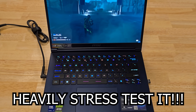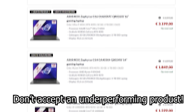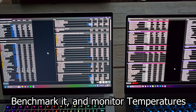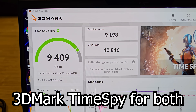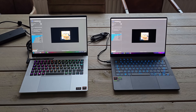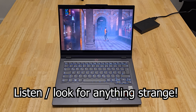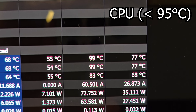It's very important that you stress test this laptop in the beginning. You paid a lot of money for it, so it should perform at its absolute best. To test whether it works correctly and doesn't blue screen or overheat due to a defect, we're going to benchmark it and monitor temperatures. I always install Cinebench R23 for a CPU stress test and 3DMark TimeSpy for a GPU and CPU mix stress test — both are free online. To check temperatures, download HWInfo64, run the stress tests, and watch the readings. Also listen for any strange noises. As long as your CPU stays below 95°C and your GPU below 85°C, everything should be fine.